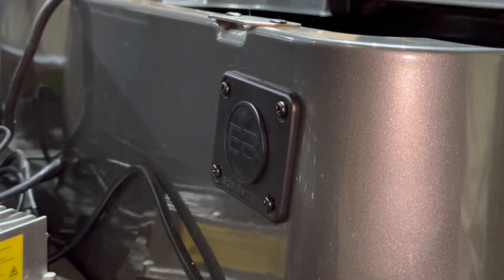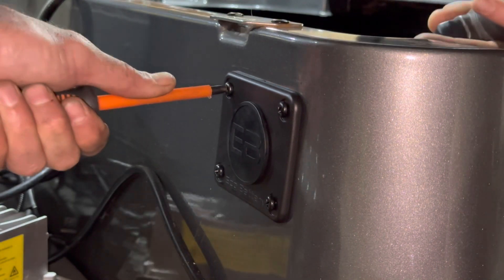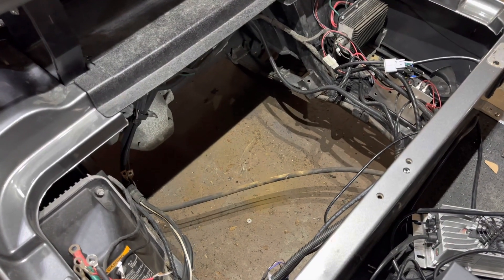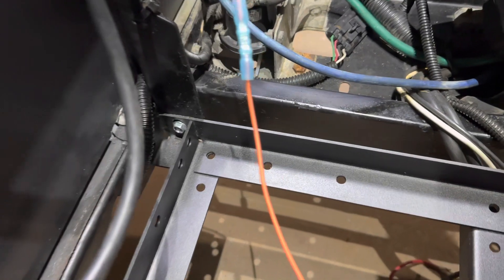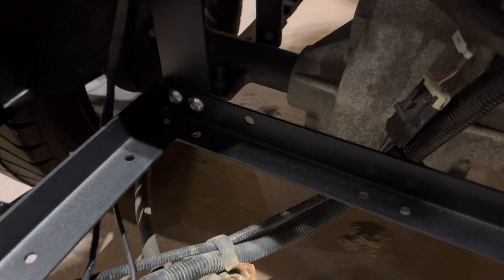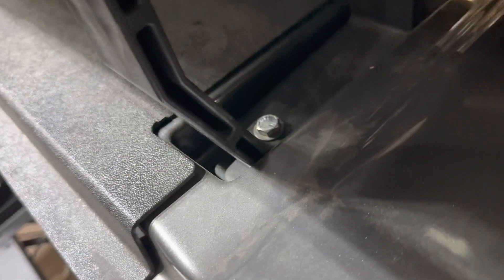Using your 10-millimeter socket and your Phillips-head screwdriver, go ahead and tighten down the mounting hardware. While we have everything out we're going to clean this battery tray top to bottom. We have the tray installed — the torque screw is in, there's the half-inch and another one in the back. We have those tightened on each corner using the supplied ECO hardware, and you have these two nut and bolt on this vertical strut, same here.